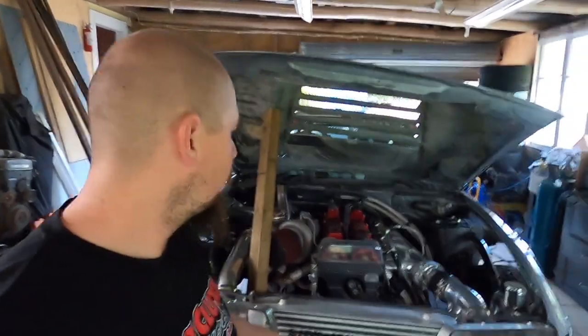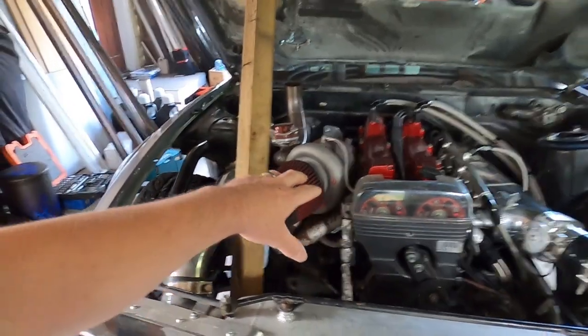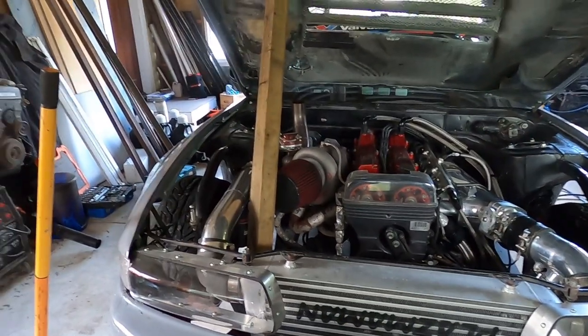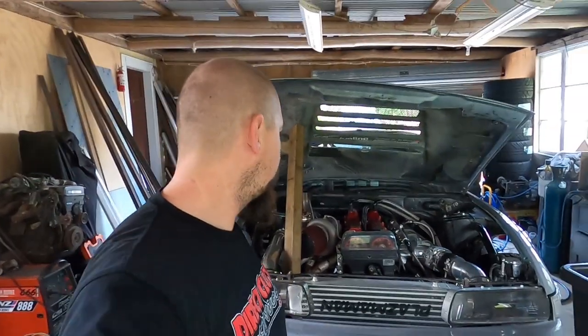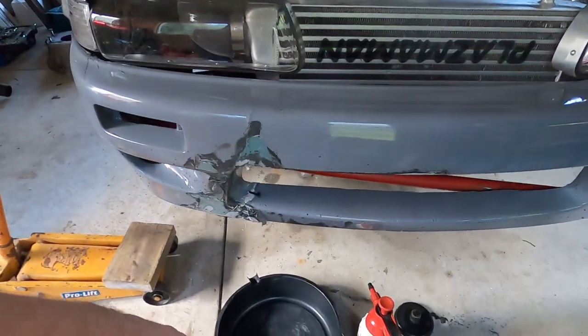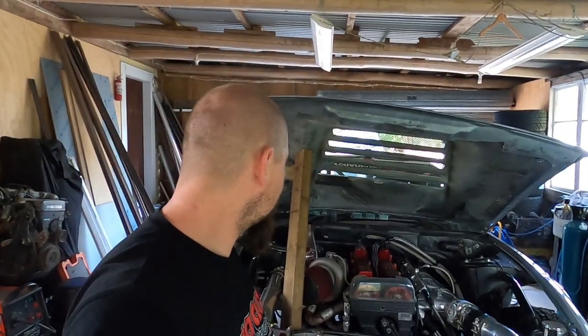It's Sunday and in a week's time on Tuesday we're heading down to Christchurch. Been meaning to rebuild this engine for a while but funds just haven't permitted. So we decided we're gonna pull the engine out today — gearbox is already out. We're gonna check the bearings and probably just throw a set in, because there's been a little bit of bearing material in the oil on the last few oil changes. It's a big event and a big expense to get down to Christchurch, so just trying to make sure everything's going to be reliable within our budget. We've cleaned out a container, gonna drain the oil and see what comes out, then I'm gonna shoot to my brother's to grab his engine crane and rip into it.